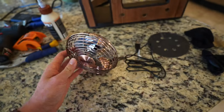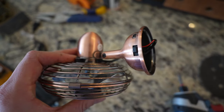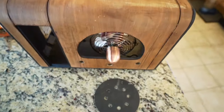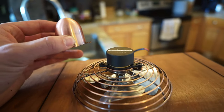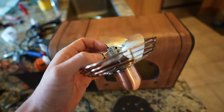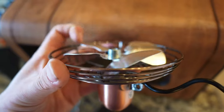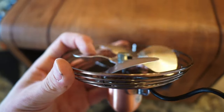Next I need to figure out the case airflow situation. I've got this little USB fan — I'm going to use this as an intake in the front. Initially I think I'm going to face the motor out so the fan intakes, but that sticks out too far. So I decided to flip the fan blade around. This is a DC motor, so I could have just reversed the polarity, but this fan looks really designed to spin only in one direction.